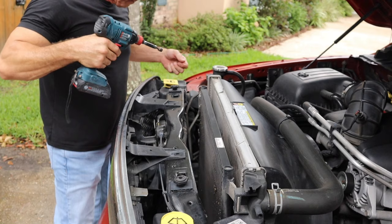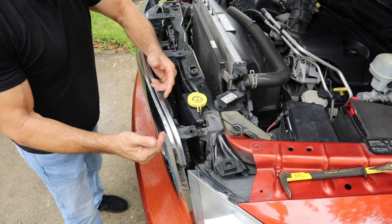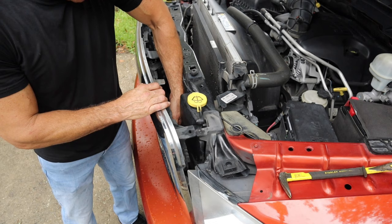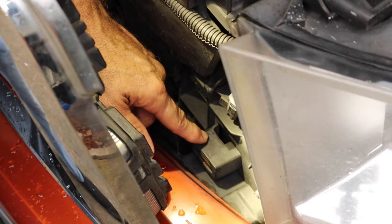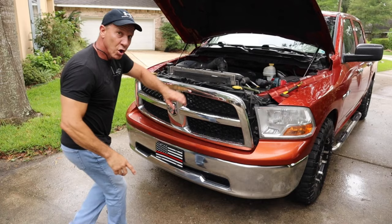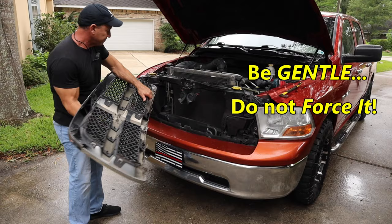You see how this is loose — this is where you have to be careful. Do not try to pull it any kind of way from up top because you will break the tabs down at the bottom. That's what's holding it in — there's a little quick snap tab on this side and the other side. Get your arm in right at the end close to the side, and push it from underneath. Sometimes they're a little stubborn if they've been in there a while, but get your hand way down in there. You see that tab — it has a little hook that goes right into the top. When you push it, it just snaps right out. Once it's released, swing it open like a door and pull this side — it pops right out. Just that easy, and you see the little hooks.